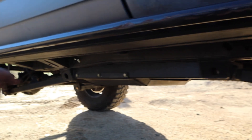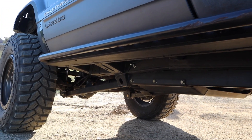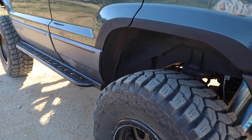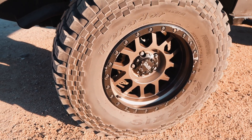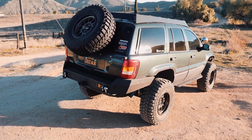The underbelly shows a Clayton 6-inch long arm kit front and rear with a belly pan that protects the transfer case and transmission — though you do have to reroute the exhaust. He's running Maxxis Trepador tires, which feel great and aren't wearing out fast. There are extended brake lines, a new fuel line, no rear sway bars, and Deviate wheels.